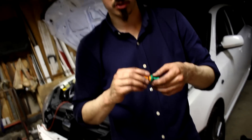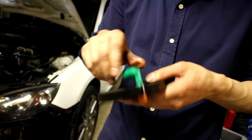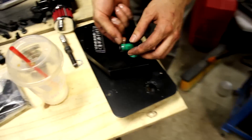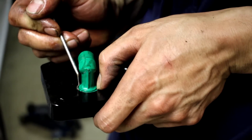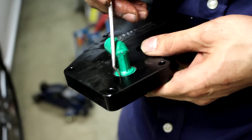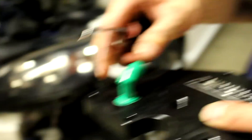We're putting a little oil on the seal to help persuade the PCV valve into the hole — there's a small ridge inside and you have to push it past that. Once it's in, you can rotate it any direction you need. Now we need to install the little C-clip to lock it in place, which takes a pick tool. It's a bit tricky without stabbing yourself, but we get it seated. That fits really nicely.